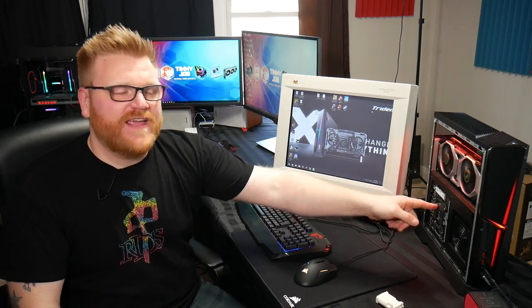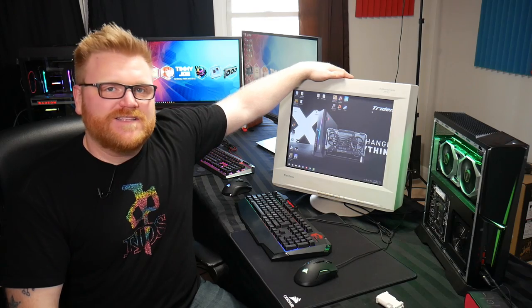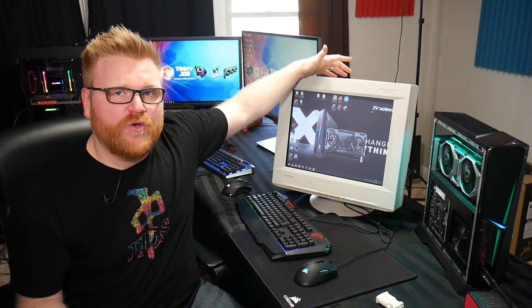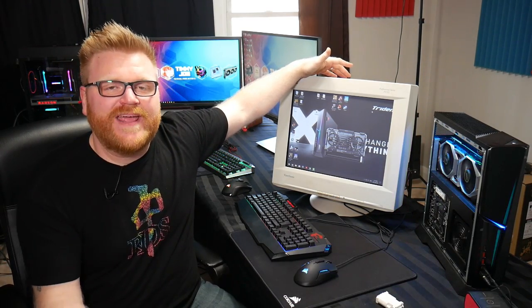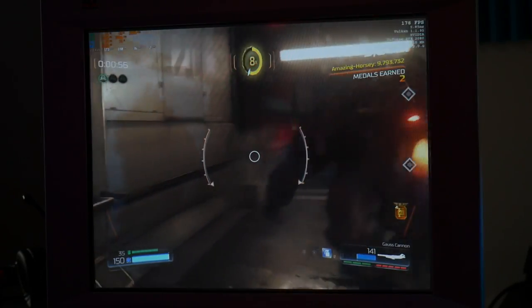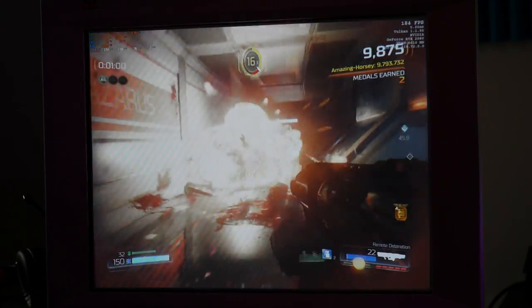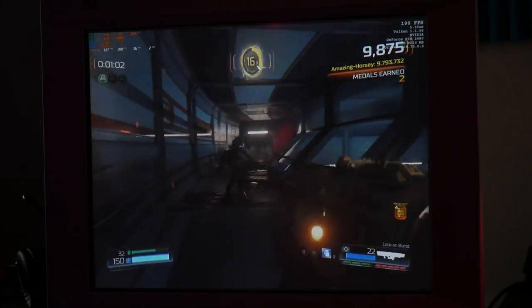And we're running on this weird little odd couple of a pairing, RTX 2080, 9700K, and the MSI Trident X, and it's outputting to this, and it's working. I believe DisplayPort is actually running in an analog mode, and it's doing the digital to analog conversion. It works beautifully, running at 1920 by 1440, a little better than HD resolution, at 100 hertz.